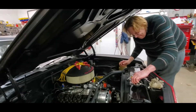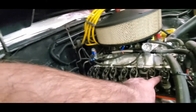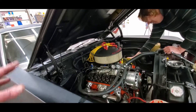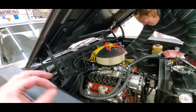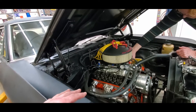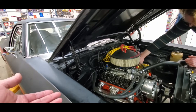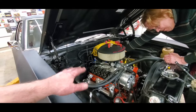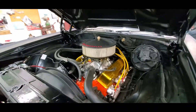We're about ready to fire her up. Got to throw the valve covers back on — always worth using nice gaskets so you can keep reusing them. One thing I wanted to point out: you'll notice almost exactly the same amount of threads poking out of every rocker now. On a machined head or aftermarket aluminum head with screw-in studs you'd expect them within a quarter thread of each other. This is a cast head — some studs may have been pushed in further or not as far, and the valves may sit a little differently since I don't know if this head has hardened seats. The fact that everybody is within a thread of each other makes us feel a little better.